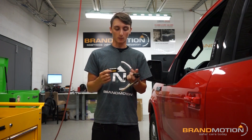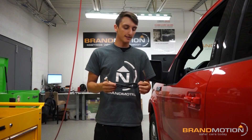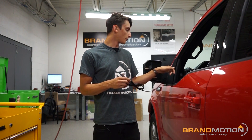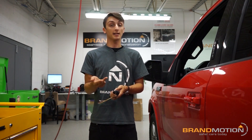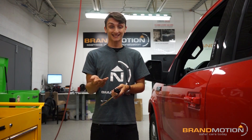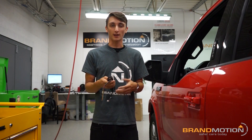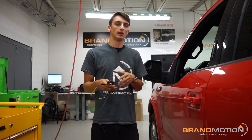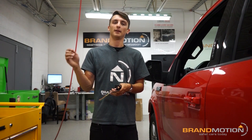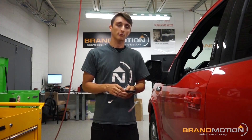This is the hub — this is what this harness is going to plug into. What we're going to have to do is run it through the driver's side of the dash. I've got to get left and right turn signal, ignition power source, constant power source, and a ground. I'm not going to go into that on this specific vehicle — it's different with every one. I'll show you how I'm going to have it set up so we can plug in the hub and then move on to getting the power connection to the ADAS itself.